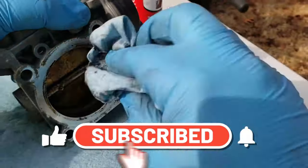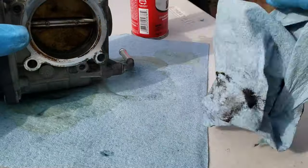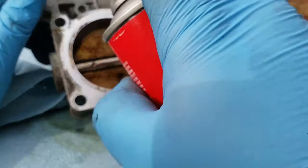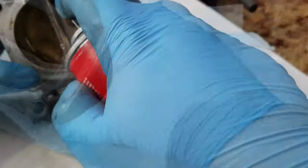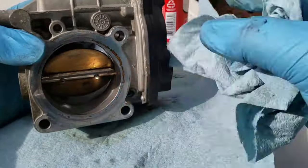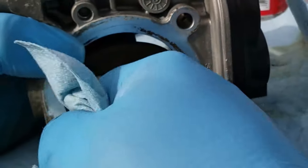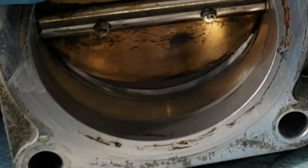Do your best to get the carbon deposits off. You can also use a nylon brush like an old toothbrush — that works perfectly. Just make sure when you're opening the throttle body plate that you go gentle with it; there are very delicate electronics and mechanical components inside, so don't let it snap back into place. There's been debate online about cleaning throttle bodies, but I've done it like this without problems — just don't pull it open or close it fast and you should be okay. Focus on the passthrough where the plate rests to get that carbon buildup out.